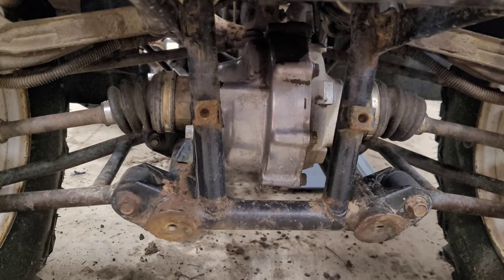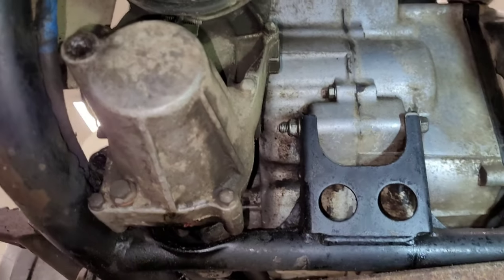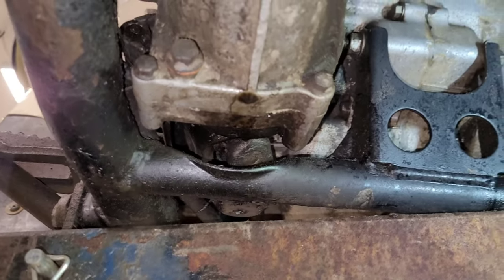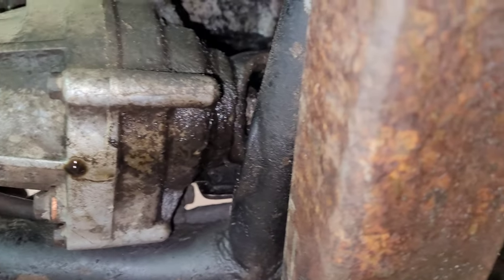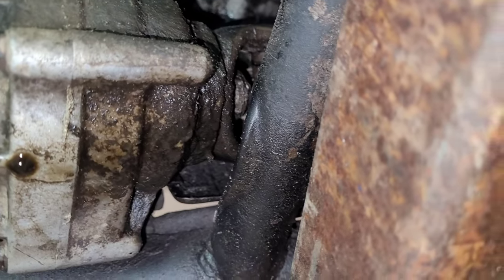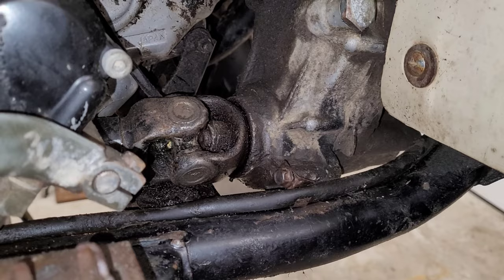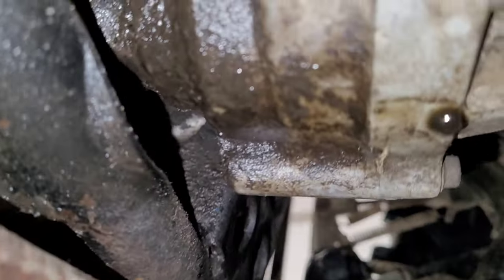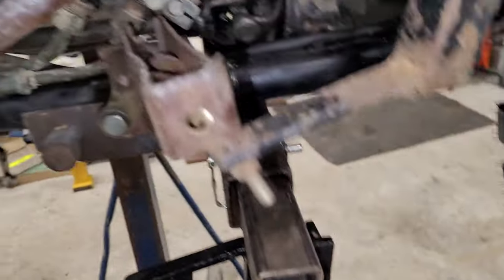It's the next day and unfortunately yes, it is in fact leaking. I had washed the drain pan completely dry. The front diff looks much better. Let's take a look underneath and see if we can find that leak. The back of the engine is looking much cleaner — I was using dish soap and all sorts of different cleaners, mixing them together, probably not a great idea, but it did work. And there's the leak. It looks to me like it's the pinion seal. I removed the cover protecting the drive shaft and yes, it is definitely wet — you can see it right there.